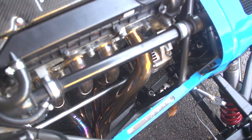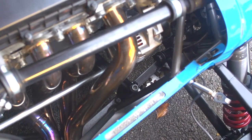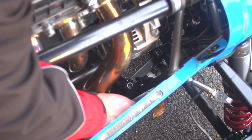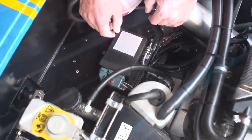Something I've found over the years is that stones that come up from the road — and also if you end up in the kitty litter on a circuit — most of it ends up in this area here. Make sure you take the time to clean that area out, because stones abrading against the chassis will inevitably lead to rust.